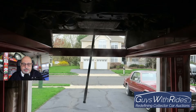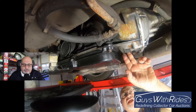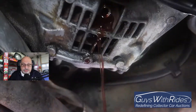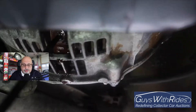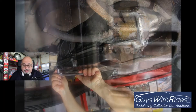It's a case of moving the engine a few degrees clockwise and then checking to see if I've got the drain plug centered. And obviously, this would have been much easier with a second person. But there in that opening of the housing is the bottom of the torque converter with the drain plug — another Allen wrench cap screw, which luckily didn't strip. You can see quite a bit of fluid in the torque converter, as you'd expect. It was a little messy, but I capped it, dried it all off, and we were good.